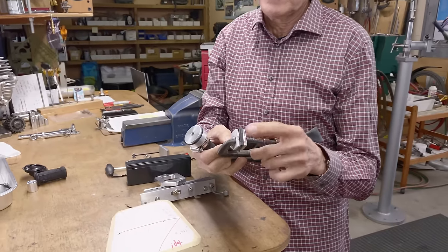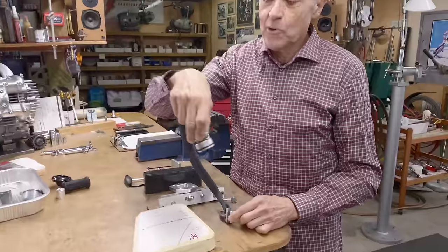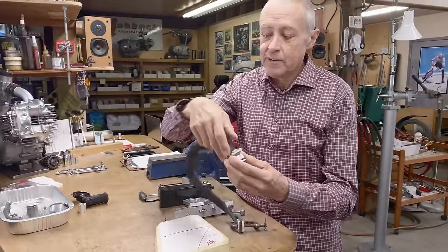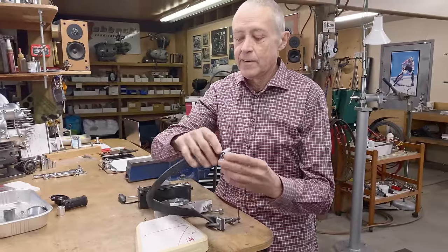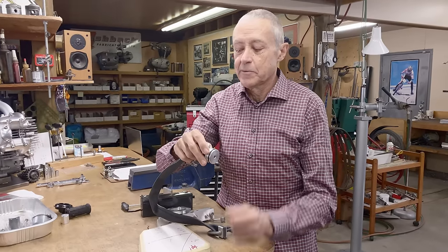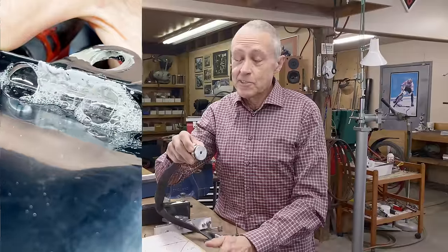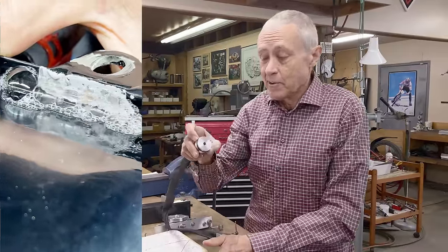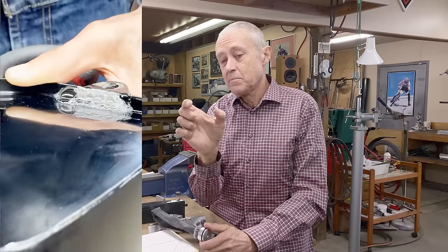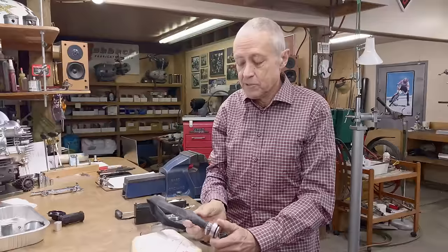I had my friend Ross here working the hand pump. One end of the inner tube is blocked off, so I would hold this down and he would pump it up. This would swell and then we would look. We had some soapy water and a brush, and there were bubbles — it was quite amazing how many bubbles came out. The crack was maybe this long. I'm going to show you a couple of photos I took.